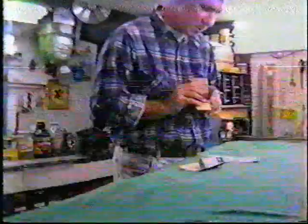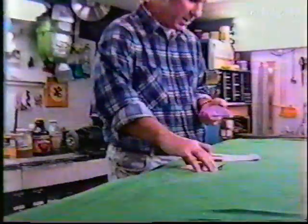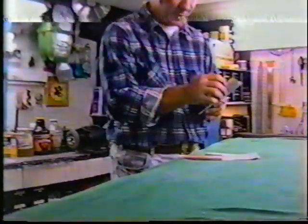Okay, this is tape 31, the beginning of tape 31. We're basically at the end of the filler coat operation, and we're going to try to get the filler coat sanded out in silver today if possible. It's absolutely pouring rain outside, so obviously we're in the winter of the building season here, just before Thanksgiving. The goal is to finish sanding this out today, shoot the silver on all our little parts, and maybe even get the fuselage in the first coat of silver.